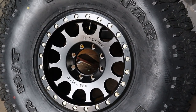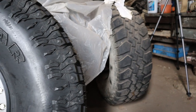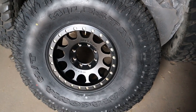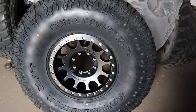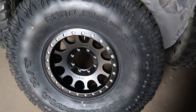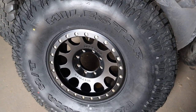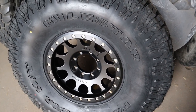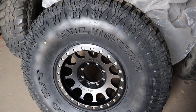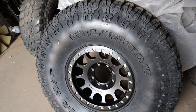Positive offset can cause a little more wear on the ball joints, so I will be getting new ball joints throughout this build, and we're also going to look at doing a better spindle lock inside the hubs - but that'll be a later episode. When looking at wheel and tire packages, also check load ratings. I did look at the load ratings on these and they are completely fine for the Humvee - no issues there.